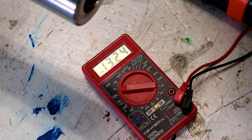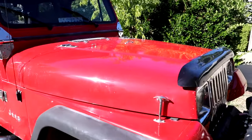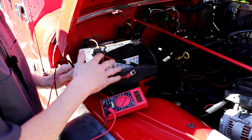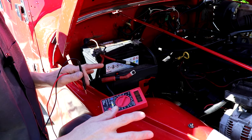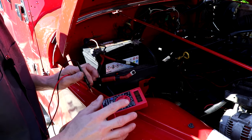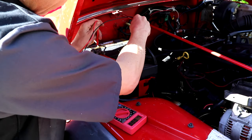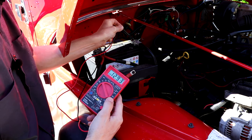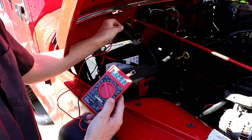Okay, now off the charger — 13.2, so that looks pretty darn good. So let's try dropping the battery into Project Fungus here and see if it'll start it up. We got it hooked up. The initial reading after I hooked it up was 13.0 volts. So I went ahead and turned on the headlights for about 30 seconds just to get rid of the surface charge. Let's see where we're at now — we are at 12.9, so that's pretty darn good. This just might work. Let's try to start it up.